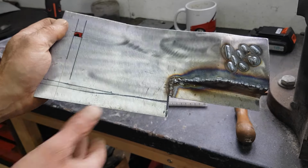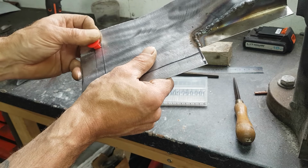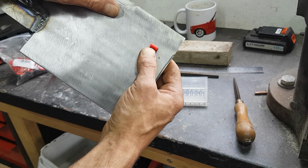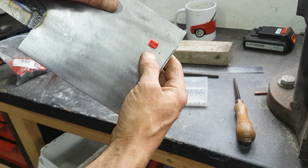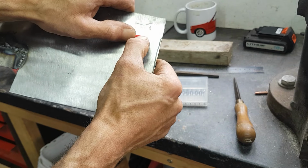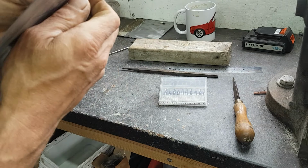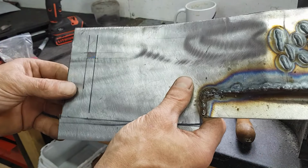So that will now take that plastic grommet for the wheel lining, and as you can see, look, it's a tight fit in there, but when it's in, look, it's a little bit loose, so when the screw goes in there, that should open it up nicely and secure it. So that's that bit done now, so that can be cut to fit to replace that other square which is rotted out.